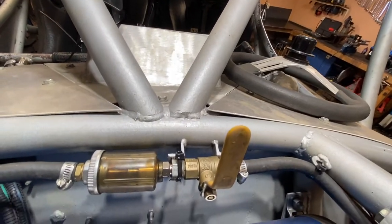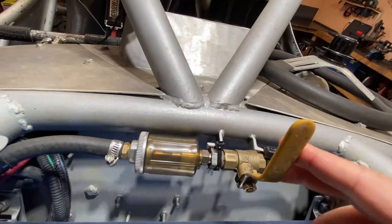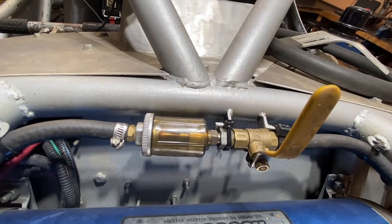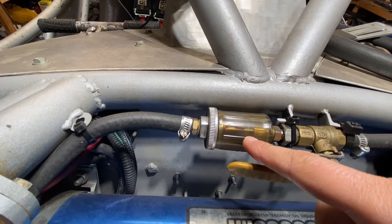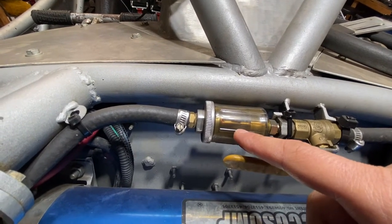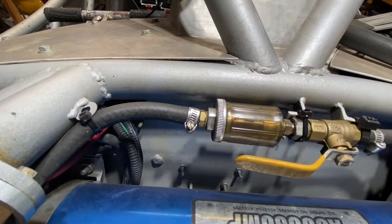The PCV is connected to a hose. I do have a manual valve on it that I can reach from the driver's side — I could extend it into the cab as well, but I can reach it from here. When I roll the buggy I just shut it off, which prevents engine oil from getting into the intake. I also put a shop-air-style oil filter on it that removes oil from the line and I empty it every once in a while. That prevents a lot of oil from going into the intake. The hose then loops back and goes inside the intake itself.